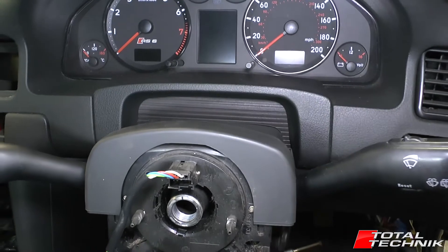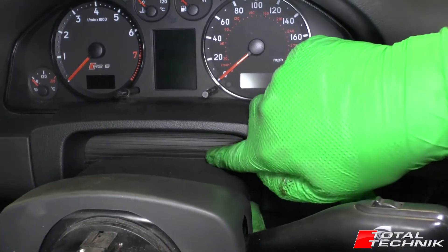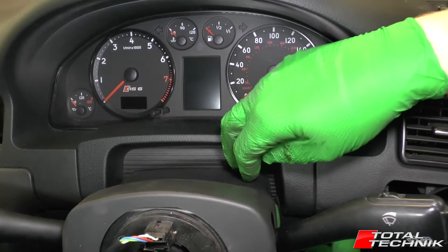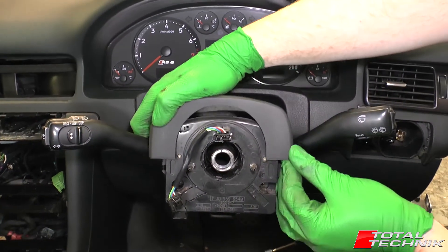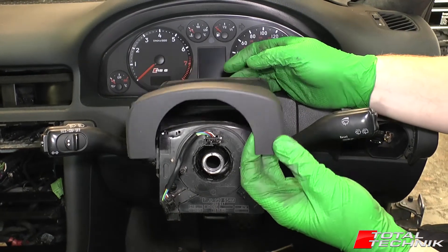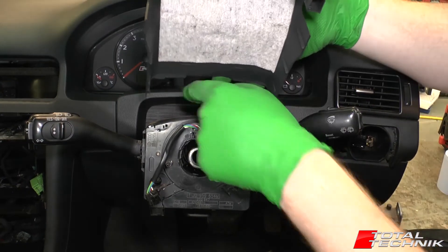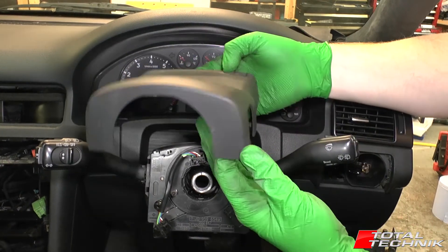With all that out of the way, it's actually very easy to remove the upper cowl. Just one thing to bear in mind: the section behind it, this little section here, is kind of spring loaded. Bear that in mind when you wiggle it forward — you do have to pull it past this, so you might want to lift it up a little bit and manipulate it. What you want to do is lift it and draw the whole thing forward, lifting that up against the springs to help clear everything on top of the steering column. Nothing gets caught as you draw this forward. And as you can see, that is the upper steering wheel cowl completely removed.